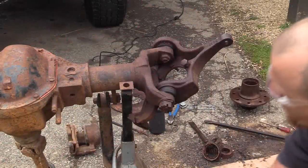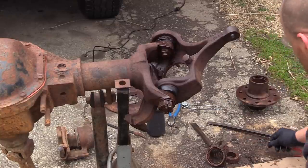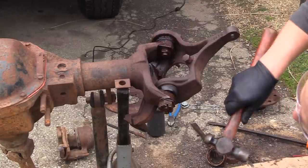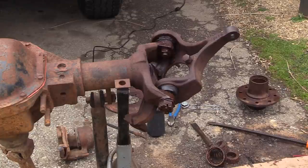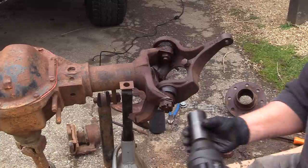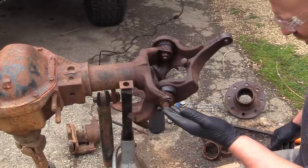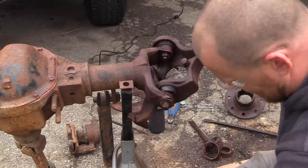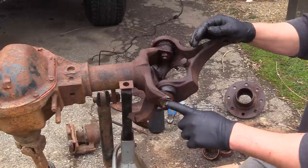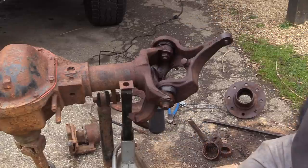Time to laugh at me doing ball joints. Sometimes when I get really rusty cotter pins like this, I just pound the cotter pin in and get your socket on there and spin it off - especially when you're changing the ball joint. That was a piece of cake. Don't fight the cotter pin on an old ball joint or tie rod when you're changing it - just spin it off, it's soft metal. The risk is when it's already separated and the taper is loose, then spinning it becomes a problem. But that was worth the risk.